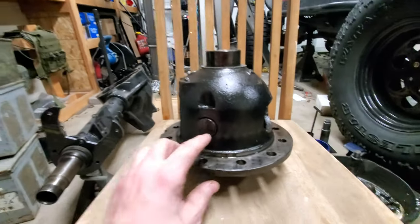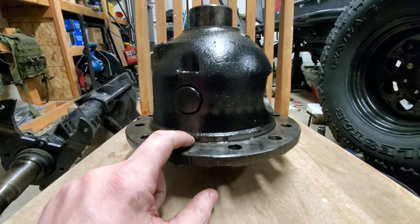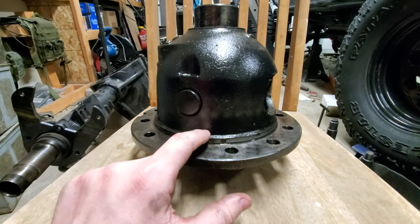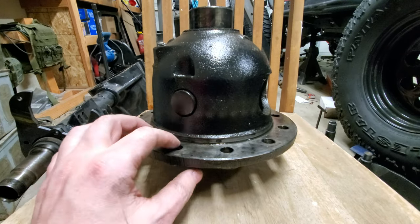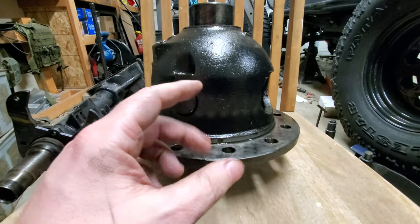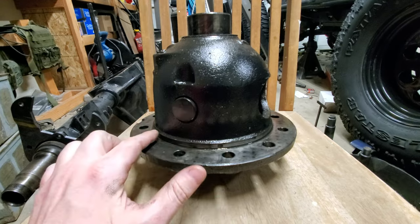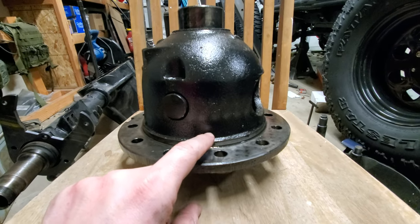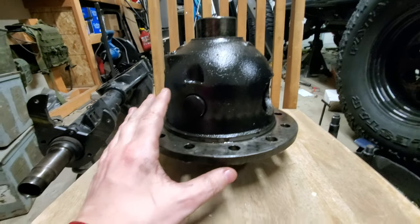What we need to do is find a way to make a spacer for my Dana 70 HD carrier so it brings that ring gear a little bit closer to the pinion that is offset so much. The ring gear would sit on here and the problem is it's not far enough up. Carl thinks we can make a spacer that'll make up that difference. But there's this shoulder that kind of centers the ring gear onto the carrier - if you don't have something like that to press it on exactly, there's some movement there. If you try to use the holes only, there'd be too much movement and that ring and pinion gear set is just going to disappear. What he's going to do is probably weld some material on this part of my locker and then machine it down so this shoulder is just higher, then sink the ring gear on there so it's nice and snug. Hopefully that is going to fix this last issue.